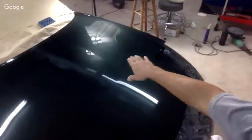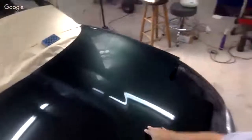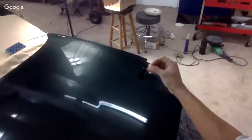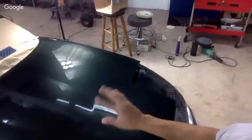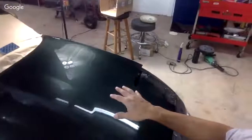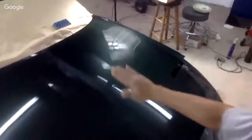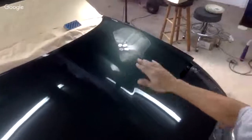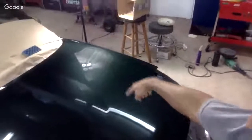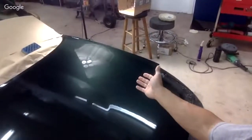And if you see little scratches in your finished job, little sand scratches, put more compound on it and keep buffing it out, because the job of the compound, the pad and the buffer is to melt your clear scratches together. You're melting everything together, which gives it that shine. So if you see little scratches in it, it means you need to buff it out more. You may need to go over it with 2,000 grit again in a circular motion to take the little scratches out. Sometimes when you're blocking, you'll get a line, like a scratch through it. When in your finished job you see a sand scratch, you're like, what the heck? So you want to make sure you go back again. It's fine. You just do the process over again.